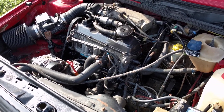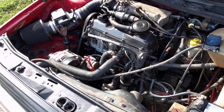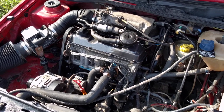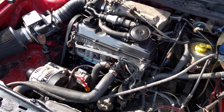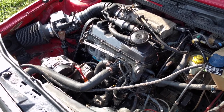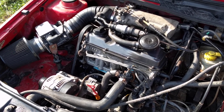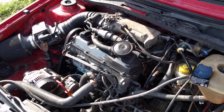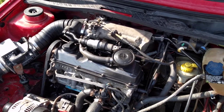I've done a lot of reading and talked to several guys that build race engines professionally — that's their job — and that's how they break in every motor, including their personal vehicles. Twenty-five to thirty miles: slow down, then punch it, run it through the gears, stay within legal limits. I could actually notice a difference in this engine after doing that — the throttle response was much crisper, the idle smoothed out, and off the line these skinny little tires really struggle to grip, even without popping the clutch.